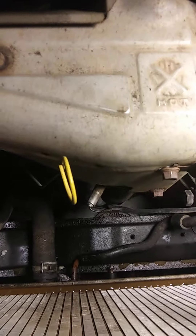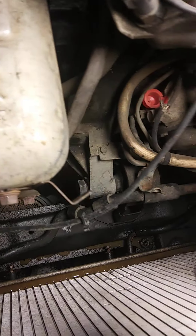I also forgot to mention: there's a draincock on the bottom. You have to drain all the coolant from the engine first. Let me get my flashlight so you can see it — that's the draincock right there, that butterfly-shaped thing right in that area. When you take that draincock out, coolant will come out, so you'll want a bucket under there.